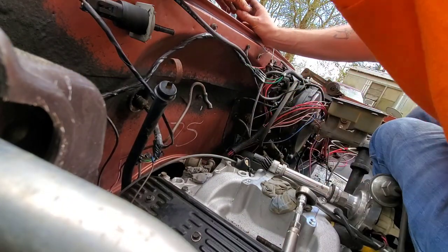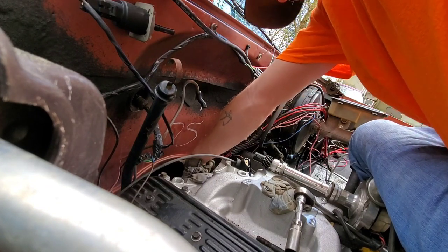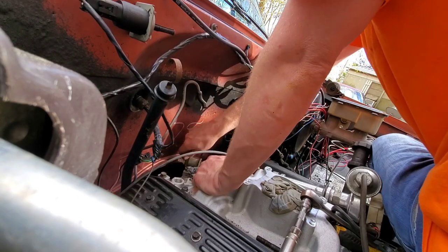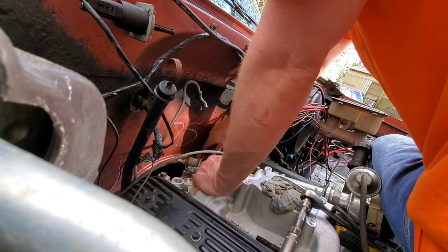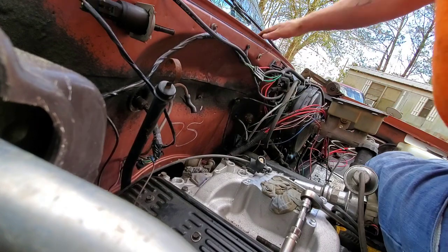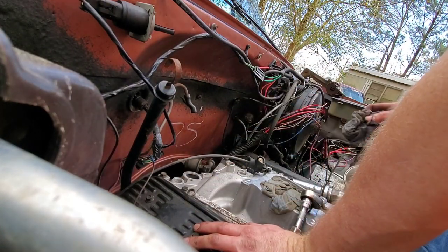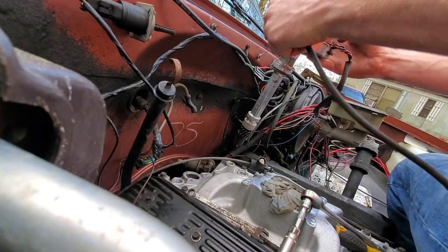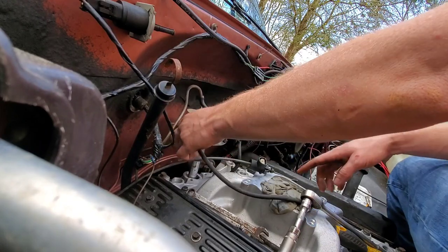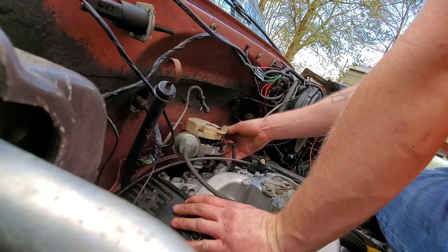Put the distributor in. It's a lot easier to get to the bell housing bolts up here, especially these top two, or really the top four. Get them two nice and tight. Just gonna rag out. I like to point my rotor button not quite at number one, kind of back at the back of the carburetor. That's where I seem to get the most adjustment at.